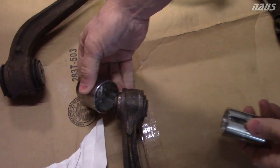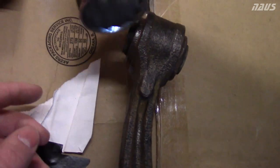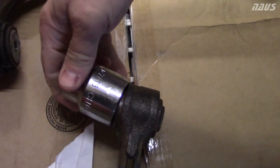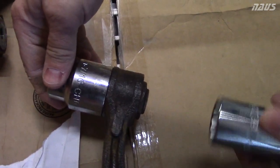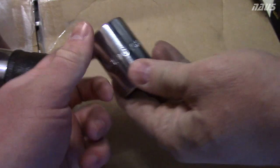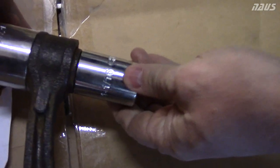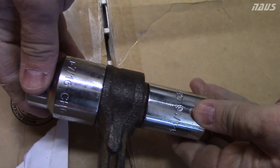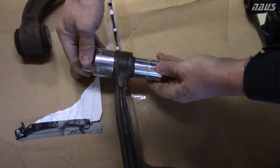On that side, we're going to be using a 3/4 inch drive, 1 and 7/16 inch socket from Harbor Freight as a clearance one. And then to push the other side, we're going to use a 1 and 1/16 inch, which lines up pretty closely with the outer diameter of the sleeve. Pretty easy setup on this one - the shock's going to be a little bit harder.